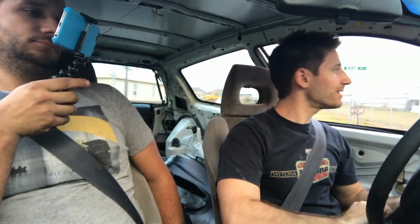Some things to clear up, which I think will make it better. I agree. Well, the 4-wire O2, because the check engine light is still on. Right. That's got to be cleared up. I do want to do the general maintenance with the plugs, wires, probably distributor cap. Yeah, I'll do that. And cap and rotor. I'm wondering about this tack, man. It's weird. It works up to about 3,000 RPM, and then it kind of just skips along. But the speedometer definitely works good. That's cool. That was a good buy, a $5 part from you both. Alright, so headed back.